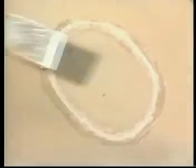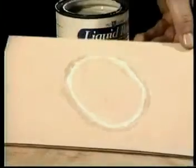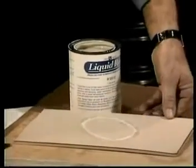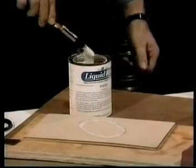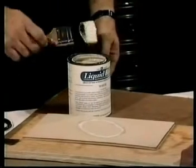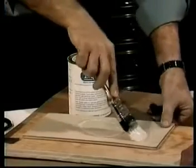Both the surface and the inlaid repair methods leave some cement or caulk exposed, leaving a weak area for future failure. Coating the repair with liquid roof matches the weathering characteristics to that of the sheet rubber and restores the seamless features of the original roof.